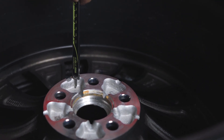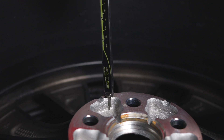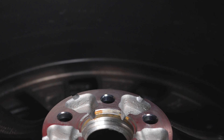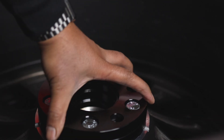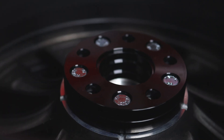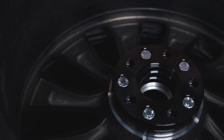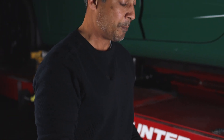There is a two millimeter difference — this will hit. If I take our simulated hub and put it in here, you can actually slip a piece of paper in here — there's a two millimeter gap all the way around. This is why you need to measure your wheels. We have looked at all of the stampings and markings on the back of the wheels; they have the same part numbers. It is impossible to tell the difference unless you physically measure. We have tried to find markings and have not found any.